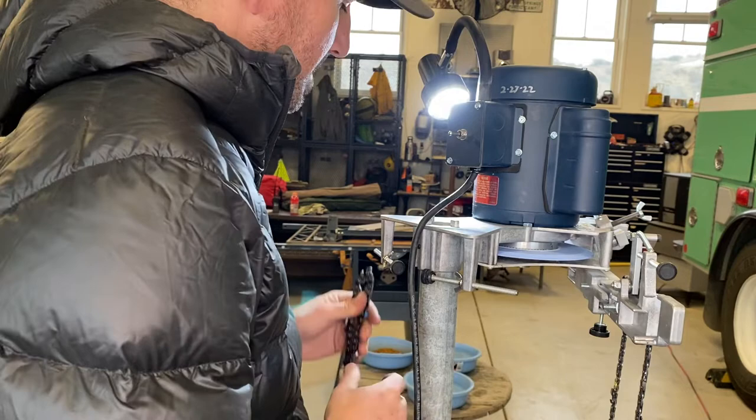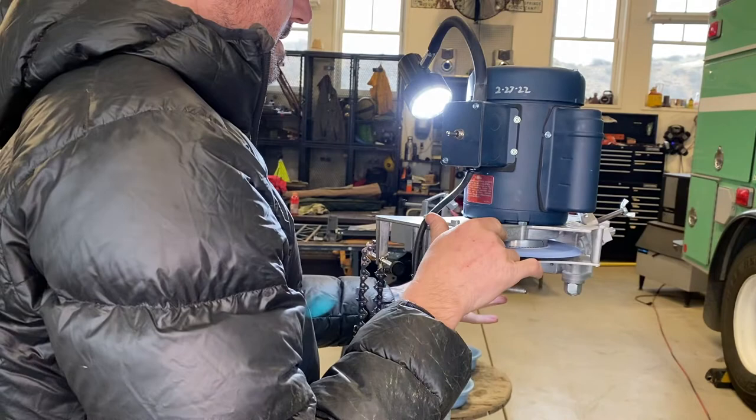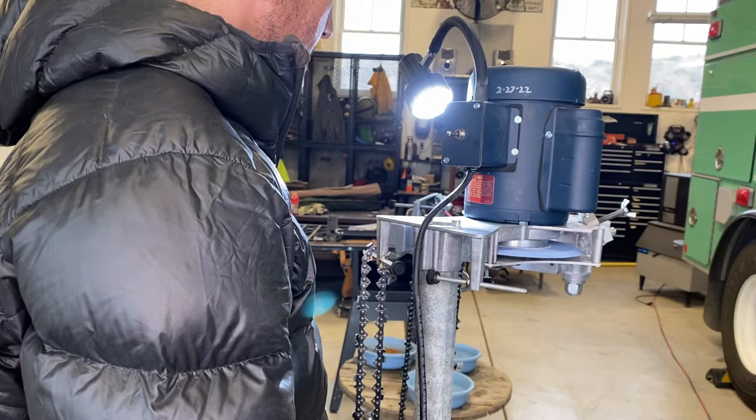You can measure what's sticking out with a pair of dial calipers to make sure you're even. On Madsen's website there are some good videos on how to check if your arm is true on both sides — there's a little test you can do to see which side you need to shim. You're only shimming a couple thousandths at a time because there are four bolts, so it's kind of trial and error.